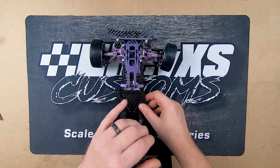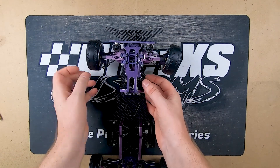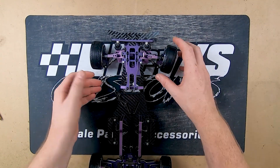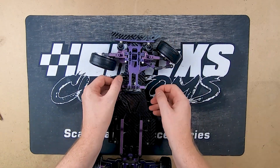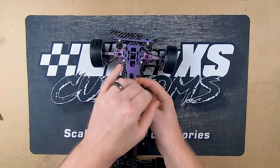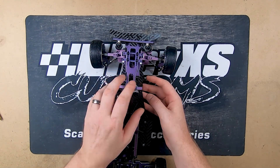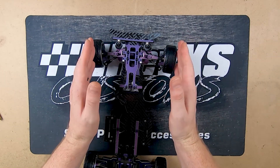Let's have a look at the front here. The servo sits back in the middle. There's no sliding rack or anything fancy on this — it's just your normal wiper setup, which allows you to see how much lock this thing gets. It's got pretty good lock compared to some other cars on the market. Up the top you can see there's adjustment for your caster as well, so there's heaps of adjustment built in. Upper arms and lower arms are adjustable for your track width.